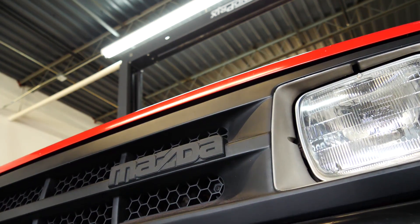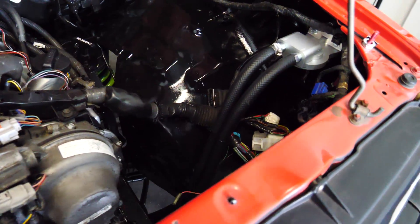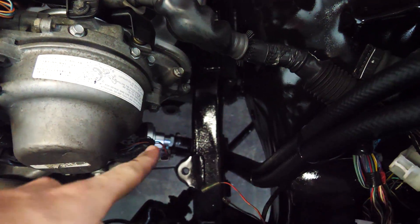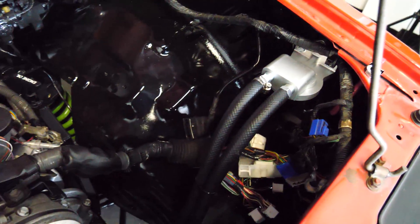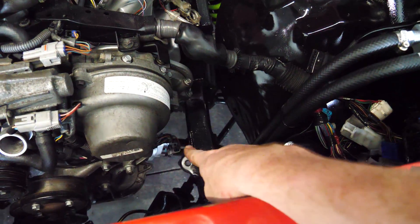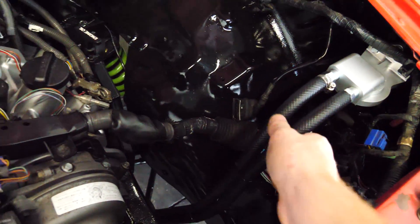Although this is the drift truck, it is also going to be an awesome street car. I actually found a way to make the oil filter relocation kit work with these fittings, so I'm going to go ahead and install this. Now the oil filter sits up here, with lines running down and back up through the wheel well, so the oil filter will unscrew right there — it's going to be super easy to change. The reason we did this is because the oil filter wouldn't fit between the engine and the frame, and now it looks cool too.